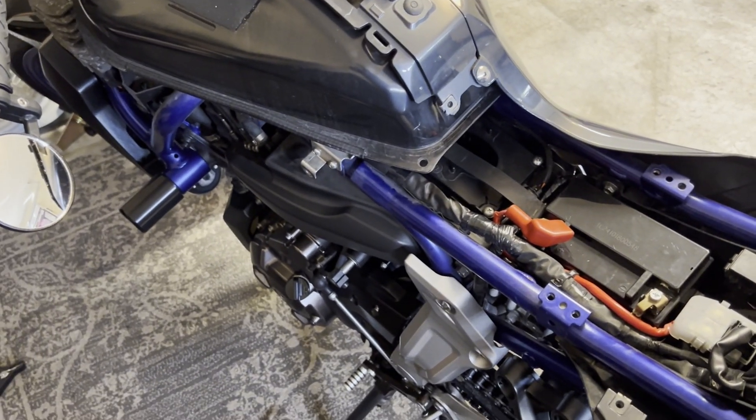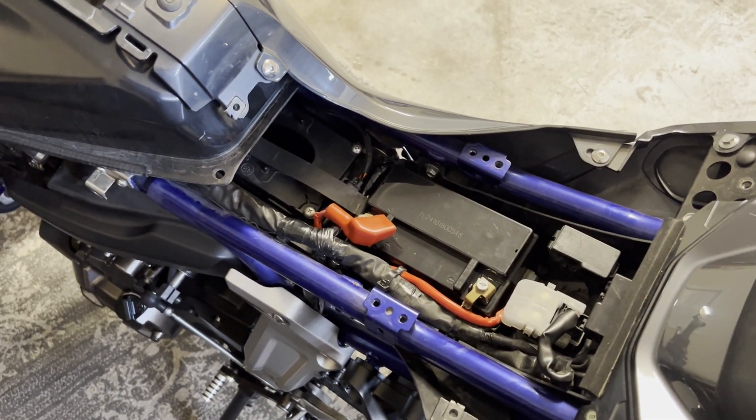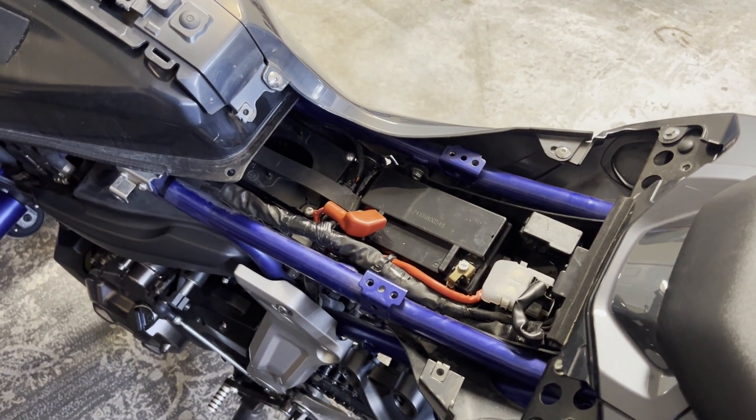40 bucks, 45 after shipping, got us back on the road. Shout out to Mel's Motorsport Parts on eBay for getting this out to me super quick — I ordered it on Friday and it showed up Monday. That is it for today's video, guys. I hope you found this information useful. If you're having charging or electrical issues with your motorcycle, use these steps to get it diagnosed and figure out what you need to replace. Some people jump right into the stator and that's not their actual problem — the issue could be the cheaper regulator rectifier. If you liked this video, leave a like, leave a comment, hit the subscribe button. I'll see you guys in future videos as we go over all the modifications and tuning we did to the motorcycle.